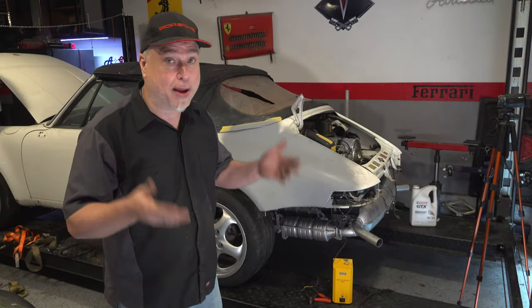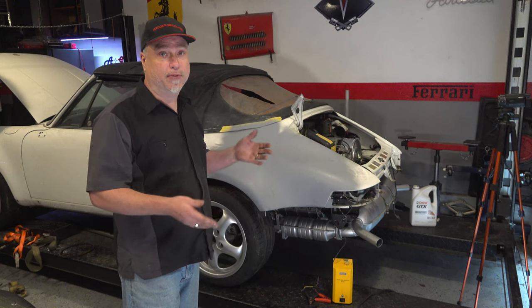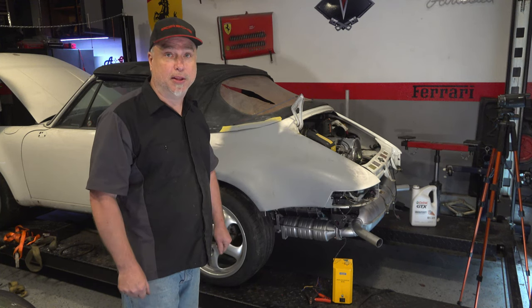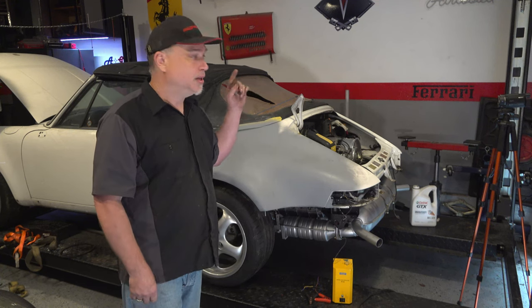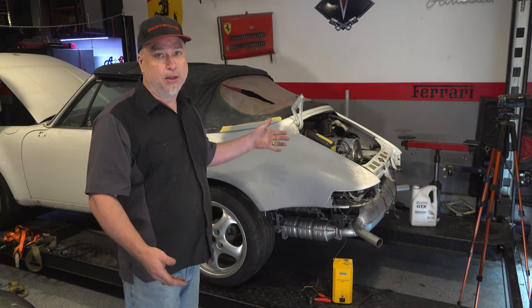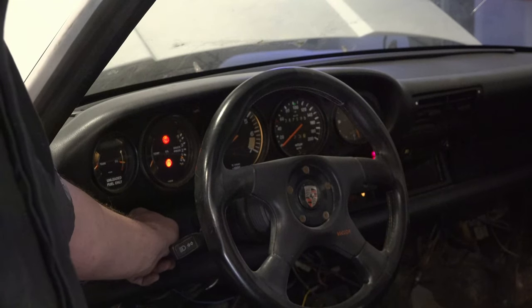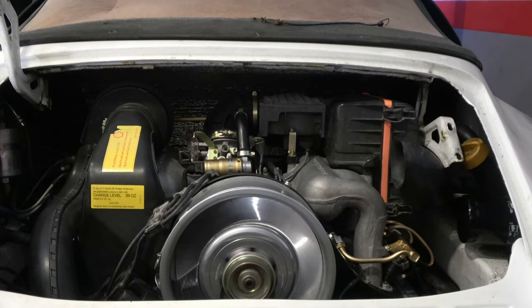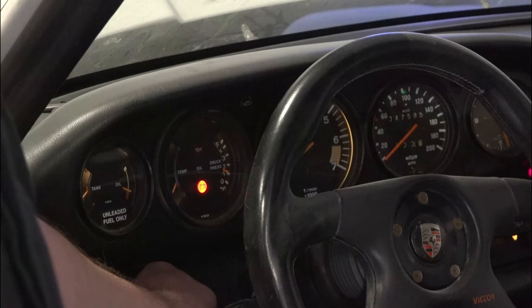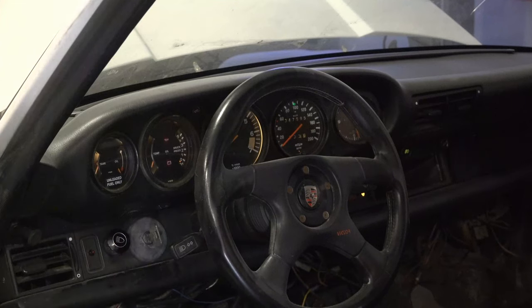All right, here it comes — here's the moment I've been waiting for. I'm going to do the same thing I did last time: build some oil pressure, make sure that's working first, and then plug in the coil and fire the motor. Right now I have the fuel pump relay disconnected — shouldn't be pumping any fuel — and the hot lead is off the coil so it shouldn't really be starting. Let's see what kind of oil pressure we got. All right, I got oil pressure. I kind of heard a lumpiness in there too — not quite sure why that is — but let's try to start it up.